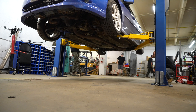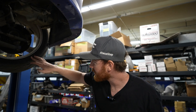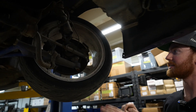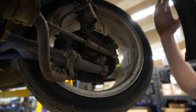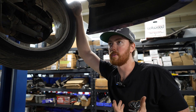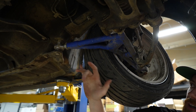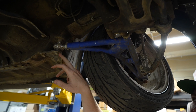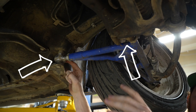Now that we've got the car on the hoist we can really get a good look at what's going on underneath. It looks like he has some adjustable control arms and a relocated tie rod on the steering knuckle. A couple things to point out right off the bat — you've got to pick up on notable differences between all the chassis that we've done. This chassis is a front steering rack car with a control arm that is a compression style, meaning the loads on the control arm are going to be compressing on this joint and pivoting on this joint.